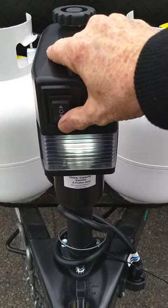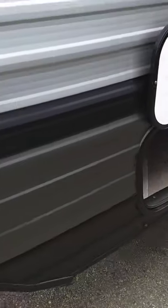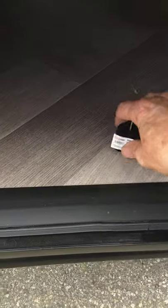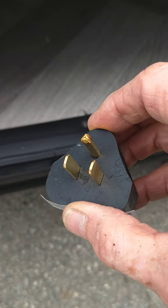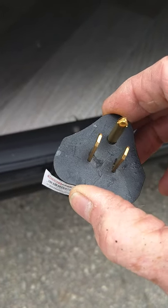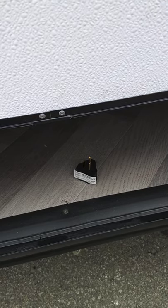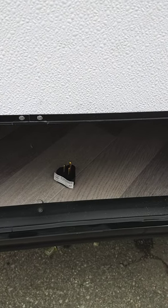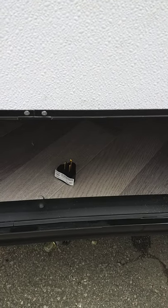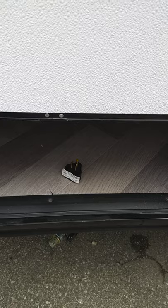You have a power tongue jack with a hitch light on it. On the other side of the pass-through storage, there's an adapter — it's a 30-amp system, and this will reduce the 30-amp plug down to 15-amp home service. Keep in mind you can run everything in this trailer plugged in at home except the air conditioner, which draws about 28 amps when the compressor cycles on and will trip your home's circuit breaker.